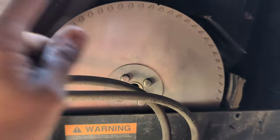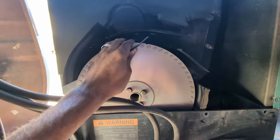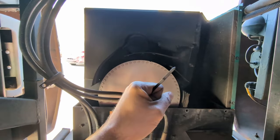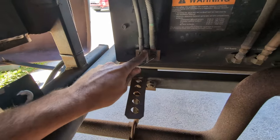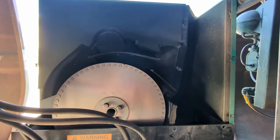Now we're behind the engine in the space in front of the coach and we can see the engine fan. We're going to remove this and then probably remove that hub or just pull that belt off. Now, if you're going to be working on any spinning parts of this engine, be sure to disconnect the battery. I'm going to lift the ground, tape it off, and zip tie it up and out of the way. Make sure you do that before you get into this.